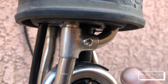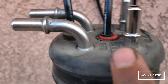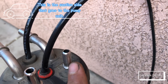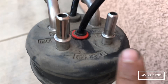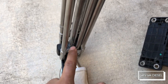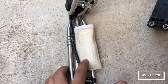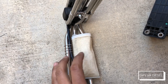Down here, the first thing you can notice is a hole — this is for the return line, they call it back flow, but they're the same thing. We have the other line that goes to the pump unit. We're going to follow it to see where it goes — it ends at the DEF filter, which protects the pump.